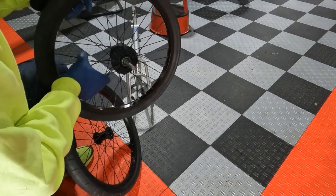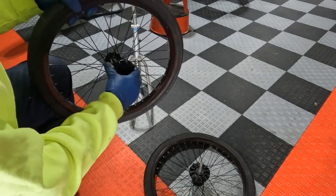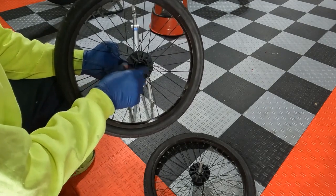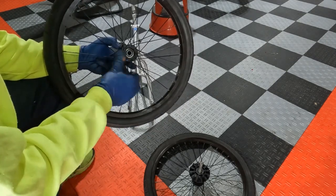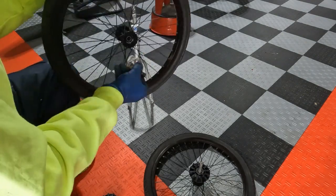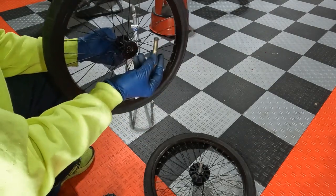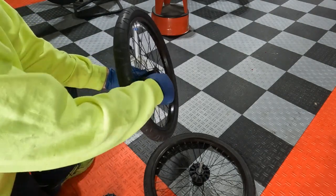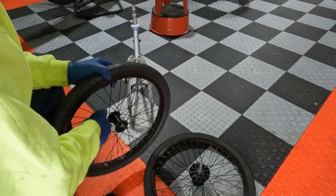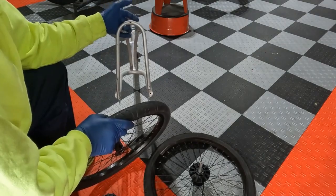One of the outer bearings is actually in a plastic piece that sticks into the hub. I pulled this off, took the bearing out, and put it into the hub itself - I'll get rid of that plastic piece altogether and just use a bolt through on either wheel. It's not like I'm going to need to remove these very often, so that's the plan. I'm going to remove a couple of tabs and look over what I've got here.